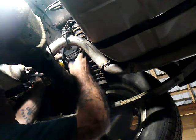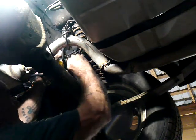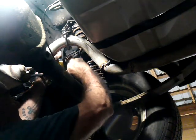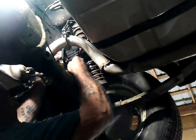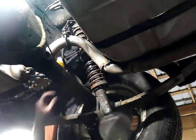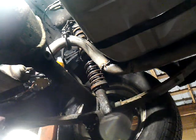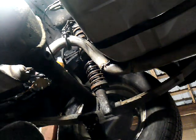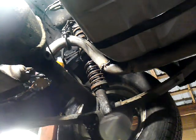So, I'm going to put this clamp back on this filter. I don't know why I chose that one, because it was closest to the tank and I wanted to fill the filter in the pump. And the pump's right after the filter here. But we're good now. She's full. I've got a siphon going, so I should be able to just turn the pump on and get fuel now. Keep that in mind if y'all ever need to get gas.